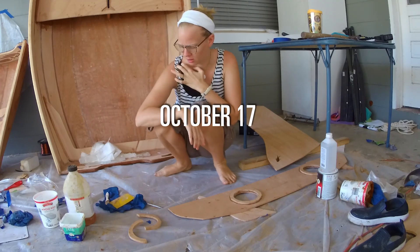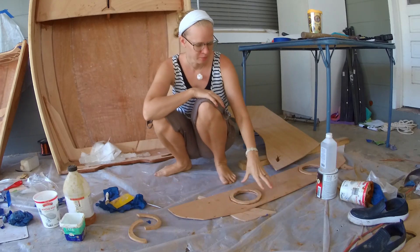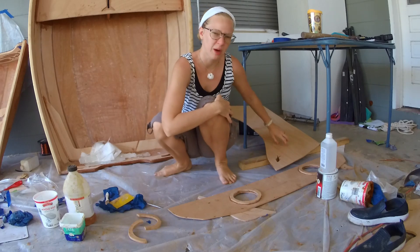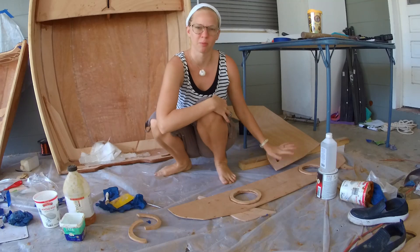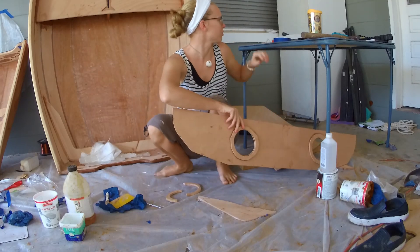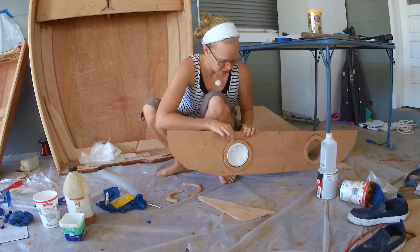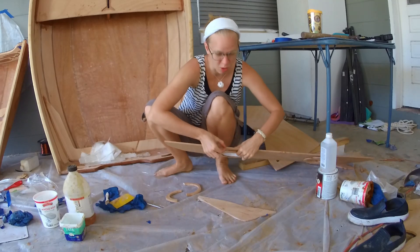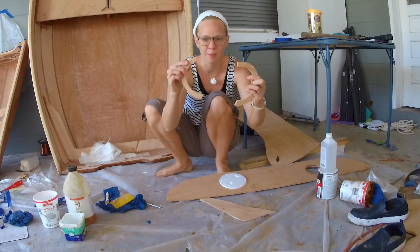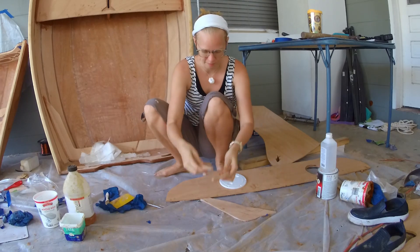Yesterday I rehearsed this all and got all my tools ready. I'm going to clear coat the back side of the bulkhead today, because once it's inserted in the middle I'm not going to be able to get to this surface anymore. So that will be all clear coated and sealed. Then I'm going to put a clear coated epoxy on this seat because it's all sanded and nice and it probably won't be that way again, so I might as well seal that up. I also forgot to put the doubler for the inspection port on the forward seat. This adds more material so that even a quarter-inch screw isn't too long for the six-millimeter plywood — the screw has something to go into. I made a ring and cut it apart. I'm going to clear coat that and then reach in and install it and clamp it from the outside, so that one will be reinforced too.